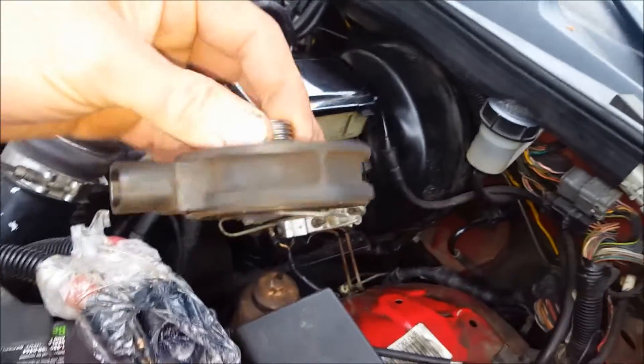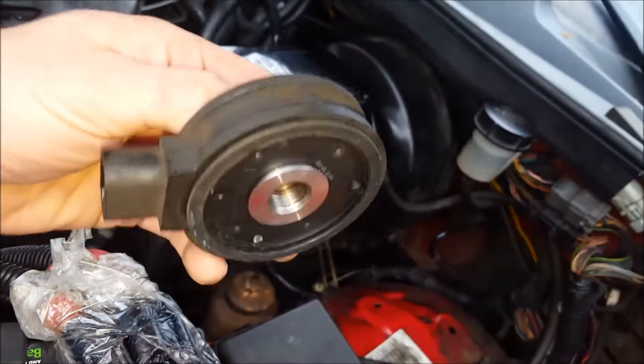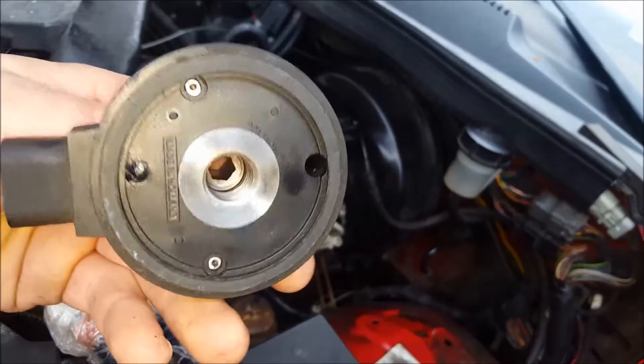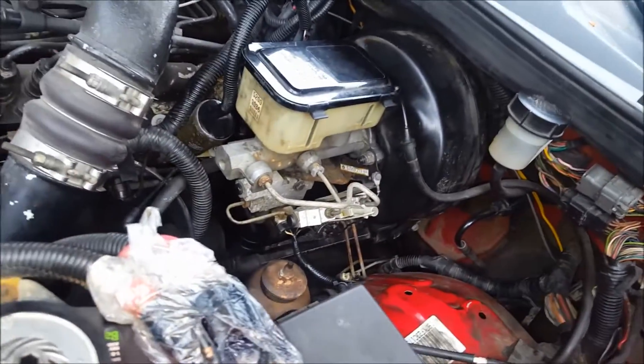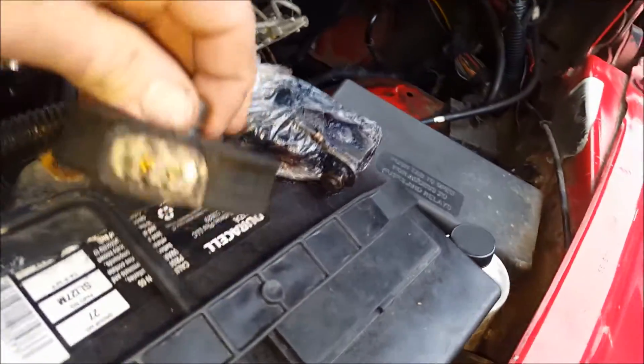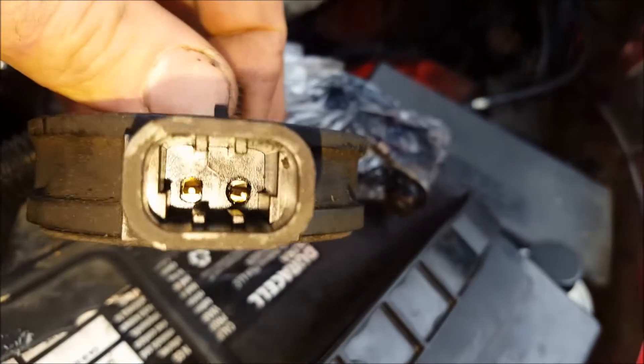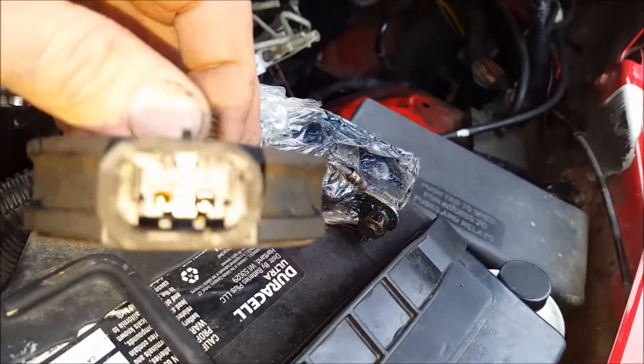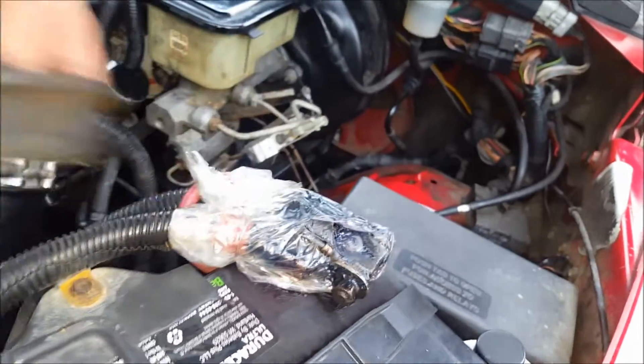I eliminated my fuel heater — that's one of the first things I did when I got the truck. That is a very common failure. It goes in between the bottom bowl — you just reuse the banjo bolt on the bottom bowl and take this out of the equation. Make sure that O-ring is good. The way these fail is the electrical connection melts, and then air pulls through because this is on the suction side, getting air into your fuel. So that's out of the equation for me.